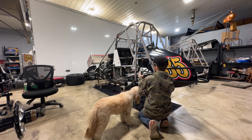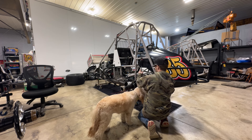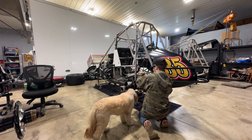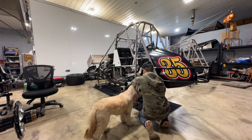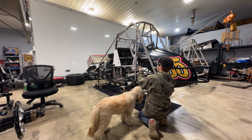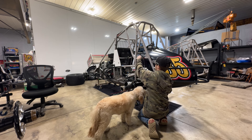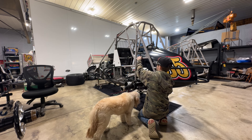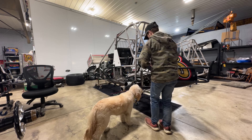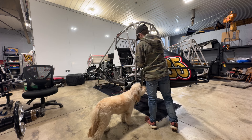It'll be better if I put the top on and then when we set the car on the ground I can actually put the bottom part on. If your shock is like that, just be careful when you do put this thing on setup blocks and go to turn weight — you've got to make sure your shock's unhooked, otherwise the axle won't actually be sitting on your block; it'll just be dangling from your shock.